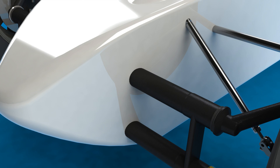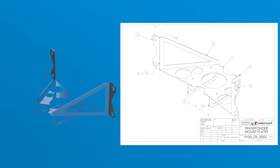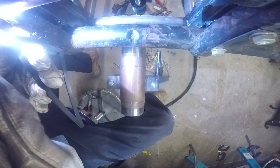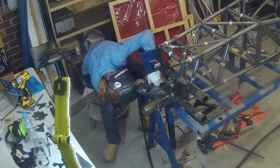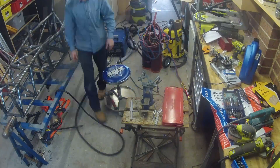While I had the H-beam on the chassis I welded together the transponder mount. This holds a beacon used by the circuit to tell when the car has crossed the start finish line. I fit it as far forwards as possible — the further rear it's mounted the later the circuit realises you've completed a lap, or more importantly finished a race. This mount was built from thin laser cut steel. There was no need for it to be so elaborate but it's so easy to draw things in Solidworks and have them laser cut that it was fine just to show off a little.